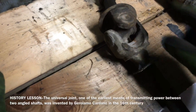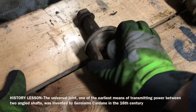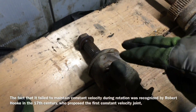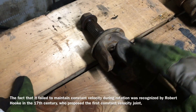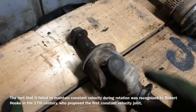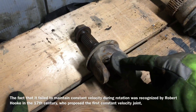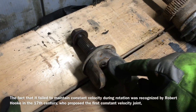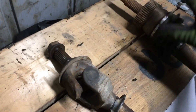You can actually change these U-joints at home yourself. All you need is a hammer, an anvil, or even a vise — it's better to have a vise but it can be done. I've actually done this with a steel rim before; don't recommend it but it works. These are not too hard to maintain. You can get ones with grease fittings, and they take a lot more abuse than the CV joint.